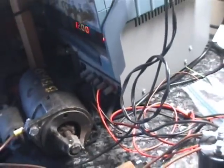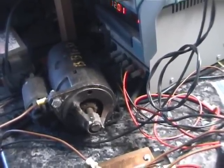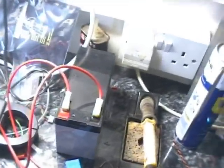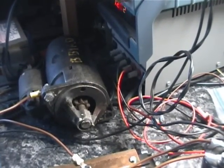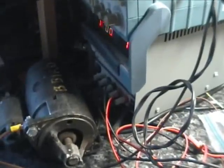I think our battery is starting to die here now, causing our starter to have a bit of a heart attack. We're going to increase the PWM a small bit to compensate. Nothing's not happy here now. Battery's gone, I would imagine. I'd say our battery is gone. And we have a nice fresh gel cell here now, so we'll try to have another attempt at getting our starter to move. There she goes. Just let that idle there at a slow speed, about 28 amps or so on that.